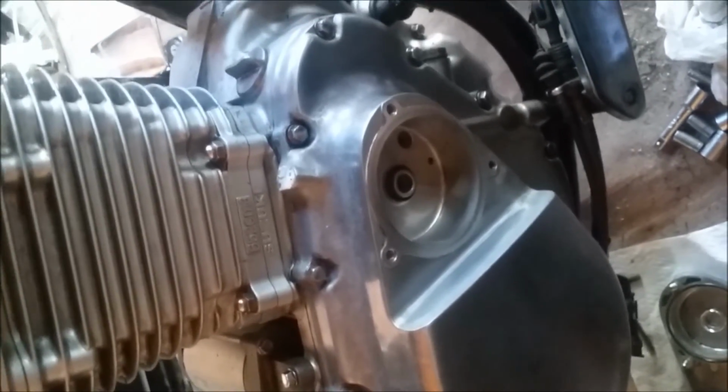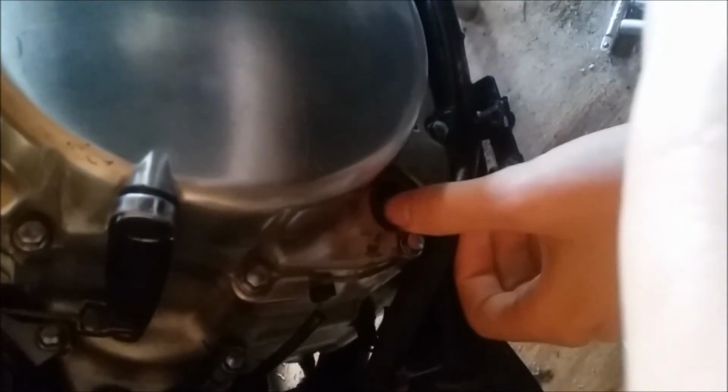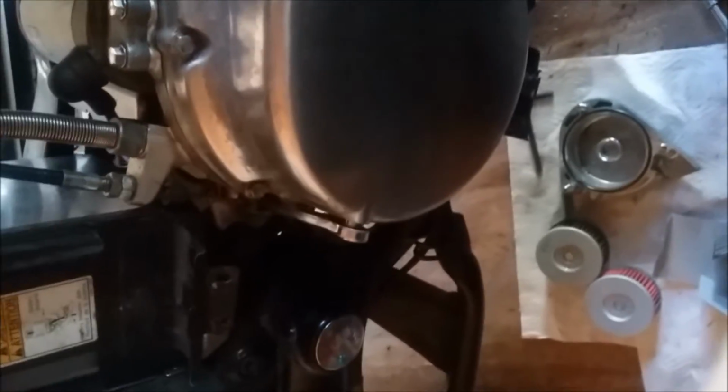It should matter depending on the bike. Right down here on your left, you have your glass cutout to see your oil amount, your oil level. There's two markings, I guess. Yeah, on the right next to the glass in the metal here. Your optimum oil level should be between the two, I believe.